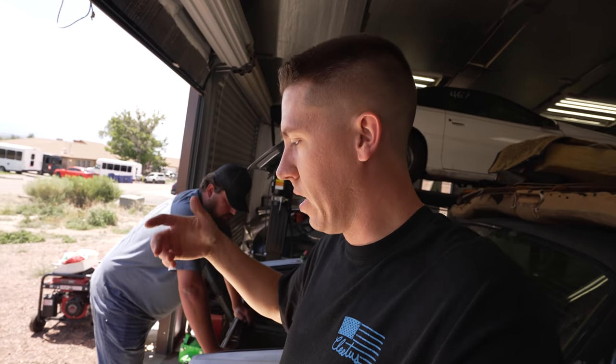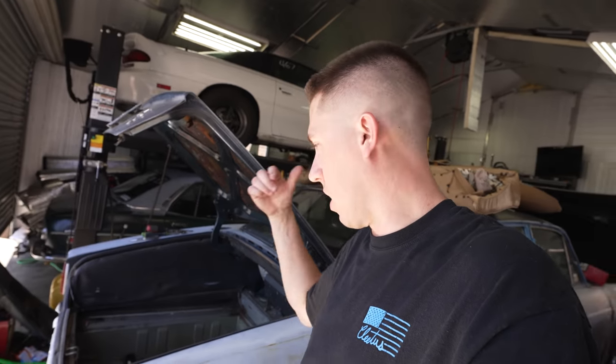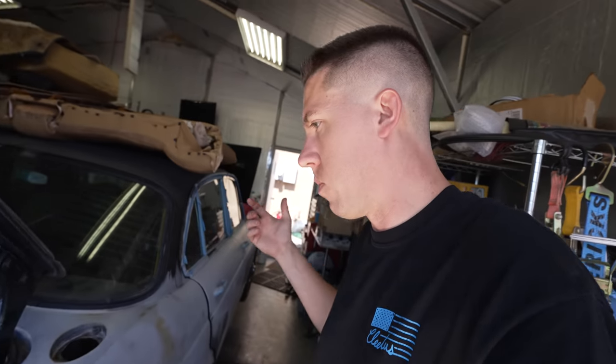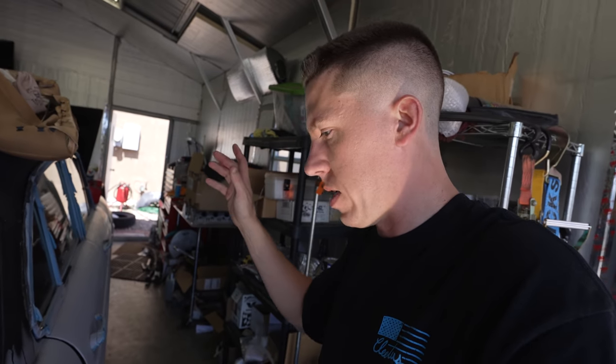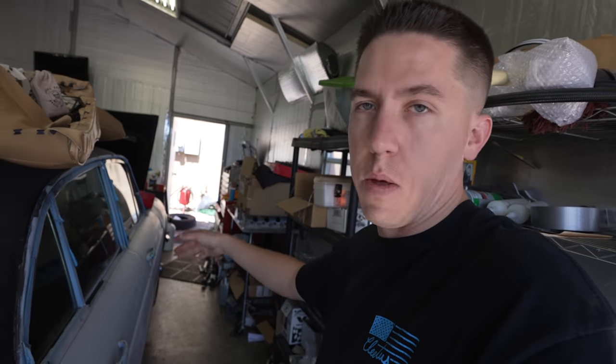Here to here is a whole separate area where the tank was. I was just thinking about this - because I'm so used to having electric pumps, it's not a big deal if you go to a pump and it goes over the rear end or whatever, but on this it really needs to kind of gravity feed that little pump. At least that helps and you don't get air trapped in the line. I guess we'll try to run it as flat and downhill as we can up to the pump.